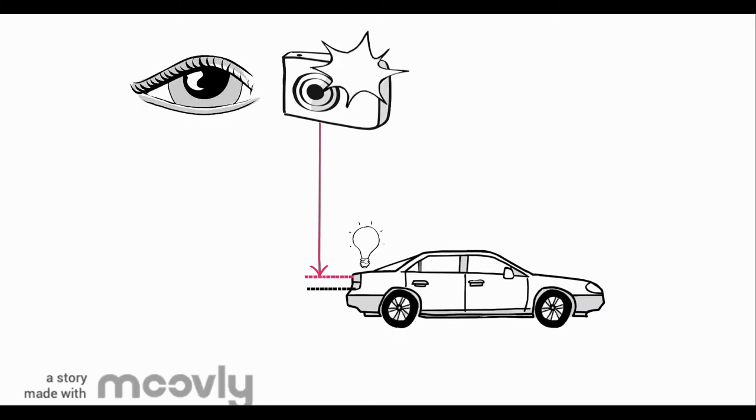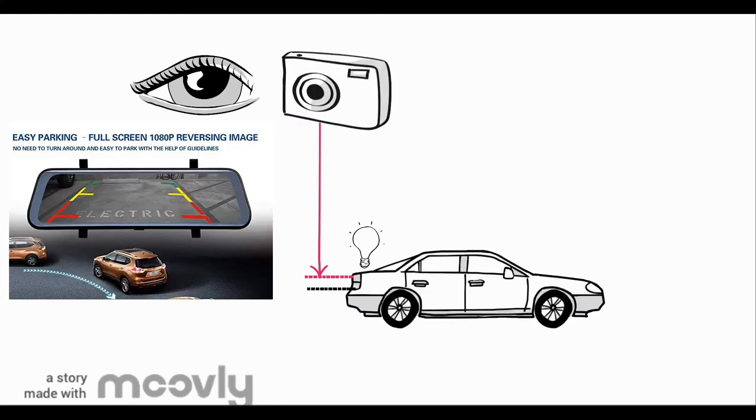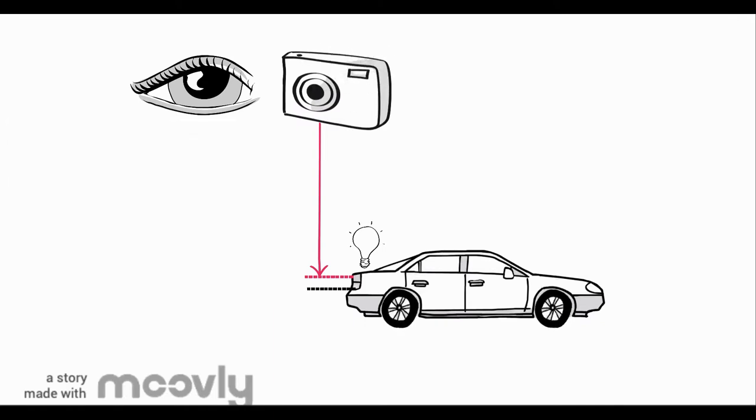The way a bulb works is simple: you apply current to the bulb and it lights up. The camera has a red wire that connects to the taillight. Whenever you put the car in reverse, the taillight comes on, and this voltage is sensed by the camera and backup mode is engaged. This is called a supply-switched circuit, and I assume most cars work like that — but unfortunately my car is a different type, called ground-switched, which causes a problem.